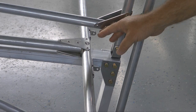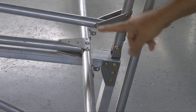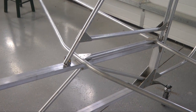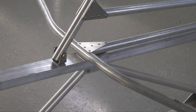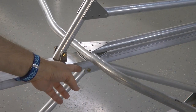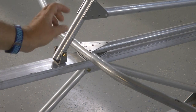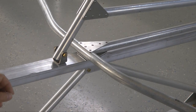Notice that working on any of this, our fin and rudder are in the way. So I'm going to remove this — we just have a bolt here and one up front — and take this off because it doesn't add any value to our mounting at this time. Once we get the rudder and fin out of the way, this will be easier to work on. We notice our front gusset is going to be mounted with an angled bracket on each side of our fuselage tube. We'll make a bracket out of extruded angle and drill through the tube on both sides.